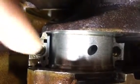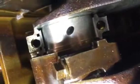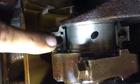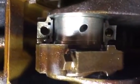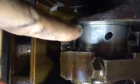She's all the way down. But look at the clearance. You see this right here? Right here it's flat, and on the side it's thick. See how the bearing just won't fall in there, right here on the side? She just won't fall — she's still going to dance. Even if I push her all the way down, the old bearing ate the crankshaft. Spun bearing.